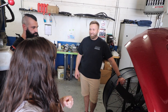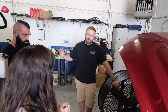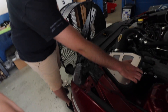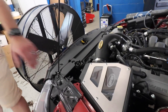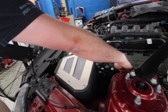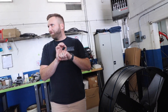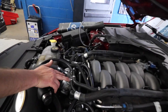Usually there's very little information and a lot left to figure out on your own. When we do installation instructions, we like to be very thorough — every step coming off, every step going back on, and every modification we made to make all the parts work. For the evaporative system, we relocate it and bolt it right off the side of the airbox, which most aftermarket airboxes have a flat portion on the back — a pretty universal location. The factory evap lines run along the frame rail, so we trimmed it short, heated up the hard plastic line, pressed the fitting in, and clamped it for a solid connection.